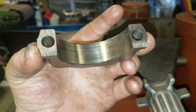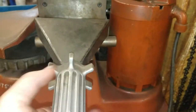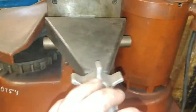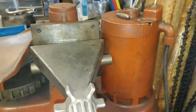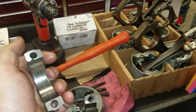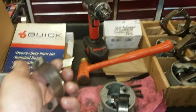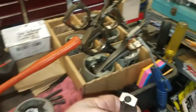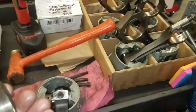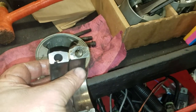Pretty good right there — the bottom needs a little more. Beautiful. Since these are not even a thousandth out around — we're talking in ten-thousandths — I'm just clipping them to clean them up, get a nice clean surface. It will probably take it smaller; how much I don't know. I'll have to put them all back together, retorque them to forty foot-pounds, take them back over to re-measure them, and then I'll hone them up. The honing will make the marks in here go away.